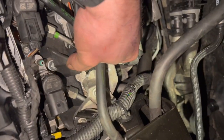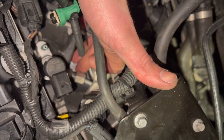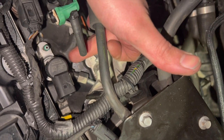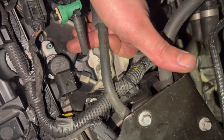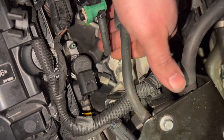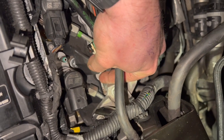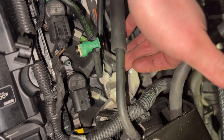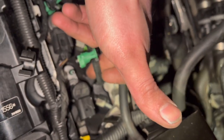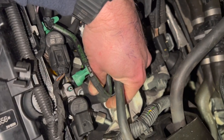I've just gently wound the eTorx bolt down by hand and got the threads started on the high pressure hose. I'm going to run these up lightly with a spanner — not the final nip yet — and then torque that down. Once I've got a light nip, I'll run you through the torque setting for the main injector clamp. When running the eTorx bolt in, just be careful — you can't afford to damage the threads in the head. If the threads start binding, do it really lightly by hand.